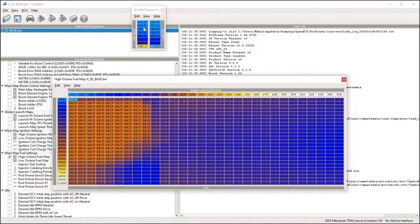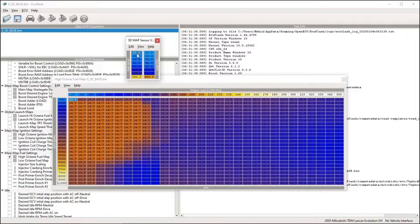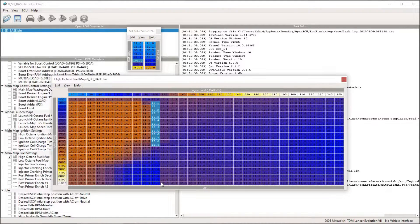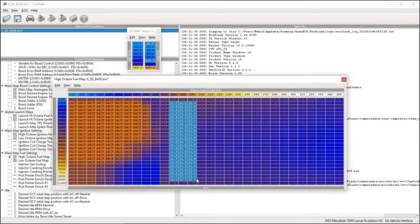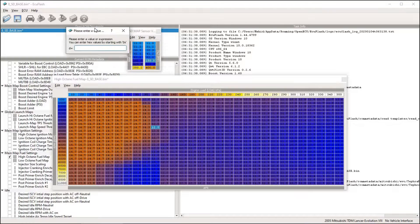Going to the fuel system — this table refers to load in kPa. Most ECUs use kPa as a standard measurement of load. If the system reads 11 kPa it'll calculate and tell it to use that column. If it sees 30 kPa it uses those columns. When it sees 100 kPa and you tell it to use, say, 150, it'll use those calculations — which is richer. Usually as load goes up you want to make it richer and richer. That is a 1-to-1 ratio versus a scaled ratio with multiplication applied.